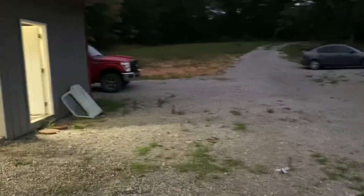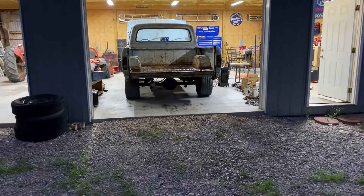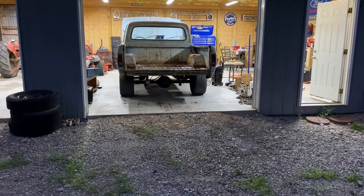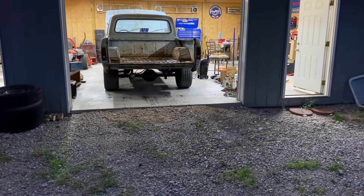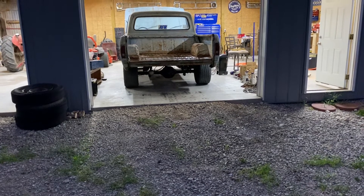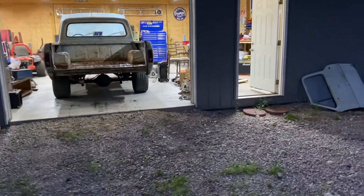So what I think is going on — it hasn't changed a whole lot since I've been in there, and I'm running an electric fan and an electric fuel pump. What I'm thinking is that the alternator just doesn't have enough amps. This is just a 60-amp alternator, and the fans are putting out quite a bit of air. I'm kind of wondering if maybe this alternator is just not big enough. I want to let it run and see if it'll just run the battery down, because if it's not charging at all — it's sitting there at like 9 volts — so we're just going to see.